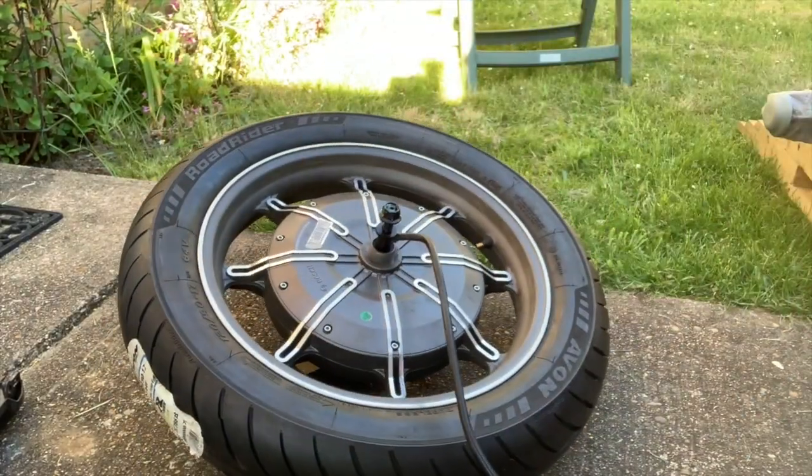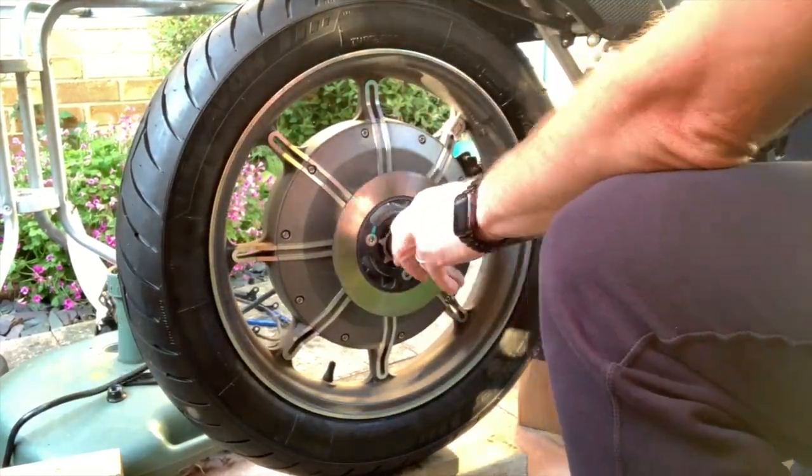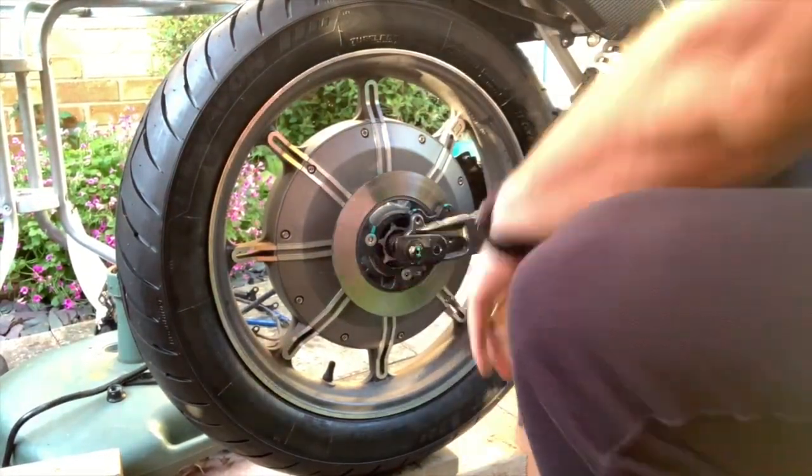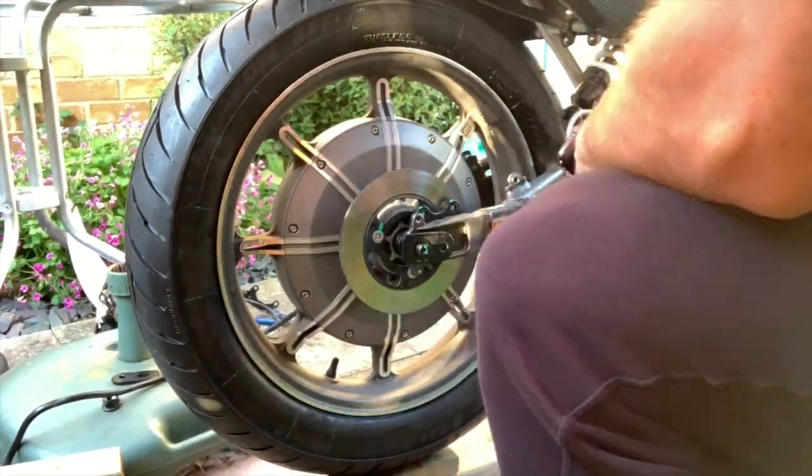This tyre I think will make the bike look really good, but it fails on the suspension — the shock absorber itself actually rubs on the tyre, and it's still got 2cm to go to meet the holes.